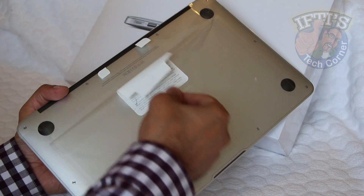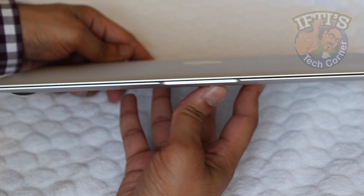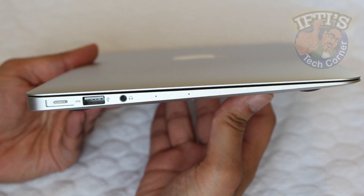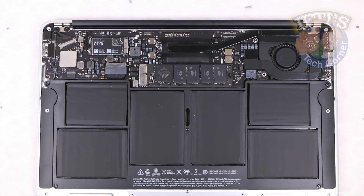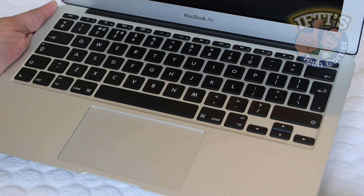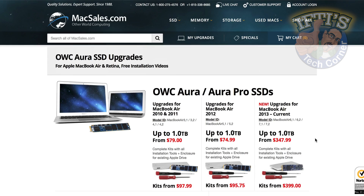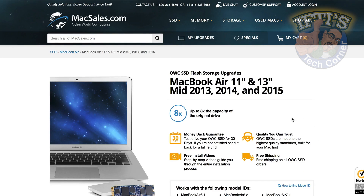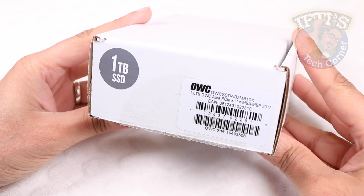Although I fell in love with the speed and portability, the MacBook Air, just like all the recent MacBook range by Apple, have never been renowned for their repairability. RAM is soldered to the mainboard and drives use proprietary connections. There's not much we can do with soldered parts, but when it comes to proprietary connections, the folks over at Otherworld Computing are quick to jump on the mark and finally give owners of the post-2013 MacBook Airs and Retina MacBook Pros a way to increase their internal storage well beyond Apple's offerings, with the Aura SSD.